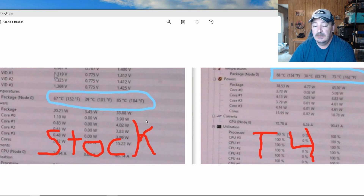I can't fully explain the lockups on the stock cooler — it wasn't temperature-related because temperatures were only showing 80°C when it locked up, which normally would indicate an unstable overclock. But it only happened with the stock heatsink, not the Hyper T4. And even at stock speeds with turbo hitting 3.9GHz, the stock cooler was already reaching 85°C without locking up.